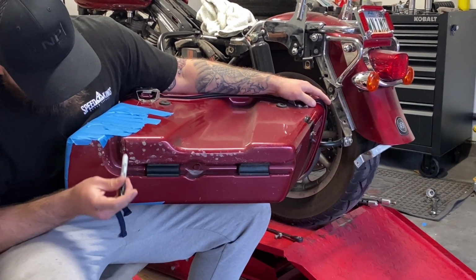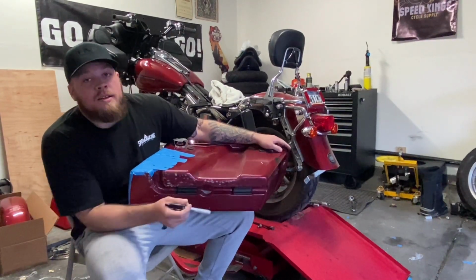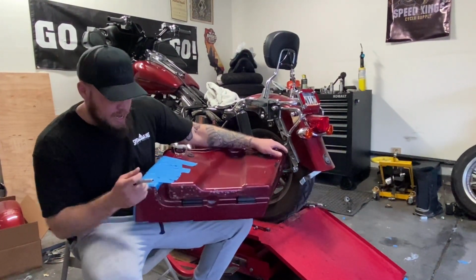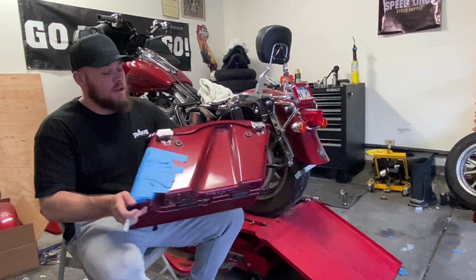on this inside part of it. Make sure that's straight all the way across. I'll get a straight edge to actually make sure it's straight. Then you're going to want to go back in and measure each side, make sure they're pretty accurate. You want to measure from this outside corner to where you're cutting out. That'll be the same on both sides.